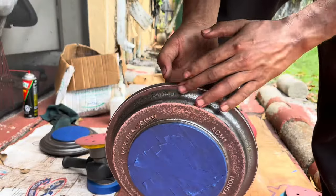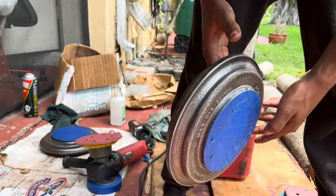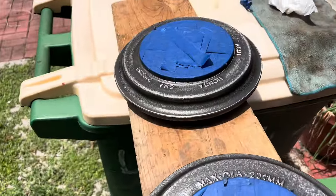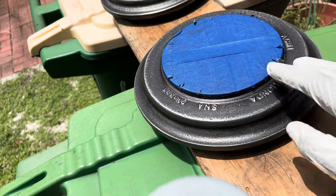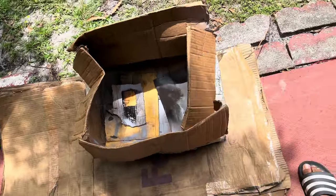The drum, it's basically smooth as hell. Now I'm gonna just prime it. The drum took the longest because of how bad they were. I'm gonna go ahead and paint it. Wipe off the oil and all that. It's drying off now. It's pretty much clean. There's no debris on it. You don't want to have debris on what you're painting because that's gonna be in the paint. But I set it up right here in my paint booth.